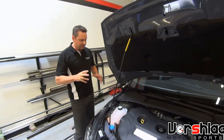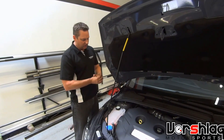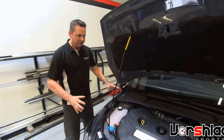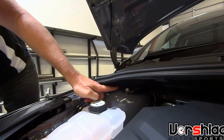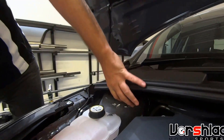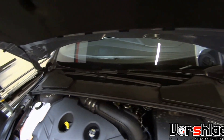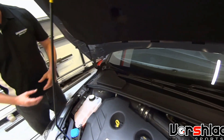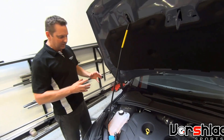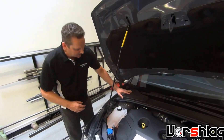One of the challenges: we want to make a camber plate — camber and/or caster — for this car. As you can see, the strut towers are buried up under all this Tupperware. So to get to the strut tower, we have to pull all of this off, which makes adjustments very difficult. You're going to have to leave this off, and that kind of leaves a big gaping hole at the back of the engine bay. So camber plates are going to be a challenge to adjust unless you're willing to cut all this up.